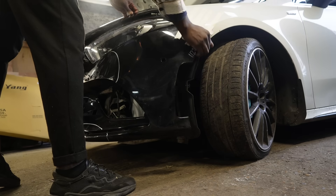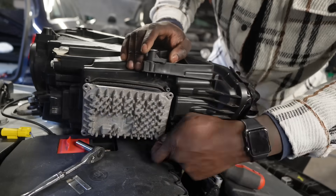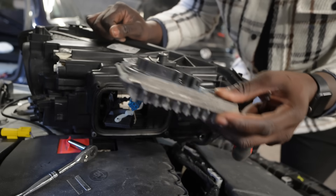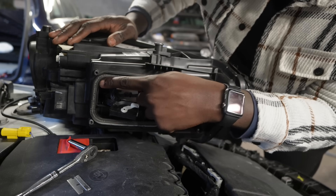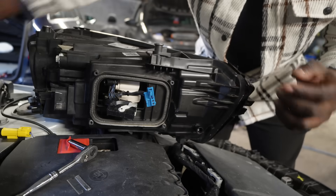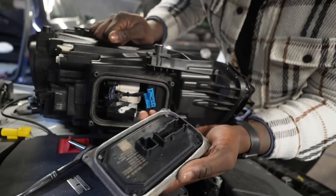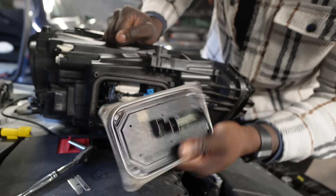Off comes this bumper yet again — and that's why I didn't do a full assembly on it, because I know it's going to be constantly changing. This is or was my original module. I messed it up because I forgot to check for this little foam gasket. It goes on the inside of this headlight — there's a little groove in there that makes contact with the rim and makes a watertight seal. I forgot to check for that the first time around. One day it rained and yeah, I destroyed it by accident. So let's fit the new one.